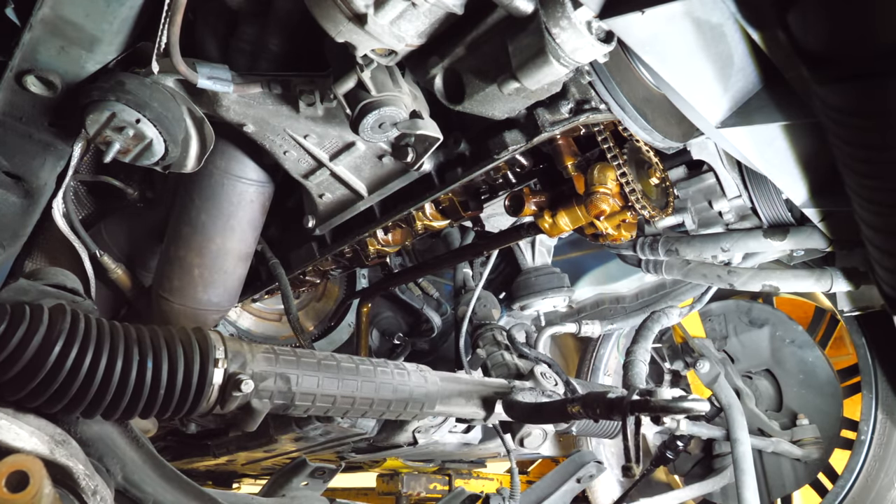This is where the train derailed. I was really happy that the rod bearing service went super smooth. There's no new oil leaks, the engine started right up, it made good oil pressure — no ticking or knocking, all the things you'd be happy about after a major engine service. However, there was still an engine noise that existed from before I did this service. Not that I thought it would fix it, but I decided to look into it. The sound was kind of a rotational, groany sound — name that sound. I've had this since I bought it, so it's not like it's a new sound. You can feel it. It goes away when you rev it. I spent some considerable time listening to all sorts of different engine problem sounds from a BMW M3 S54 engine — ticking and knocking and rattling and all kinds of stuff. And I only found one video where it sounded the same. Only one.